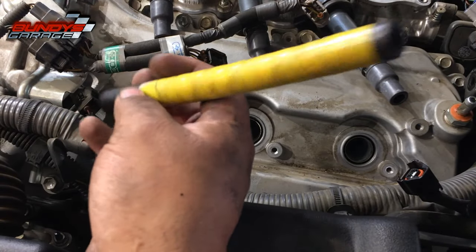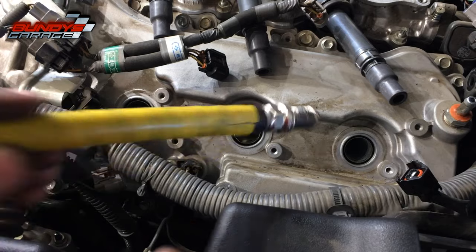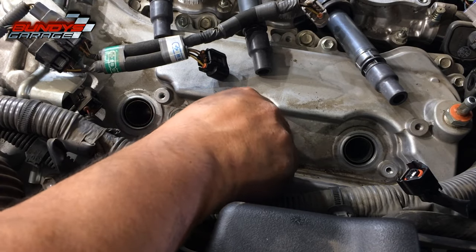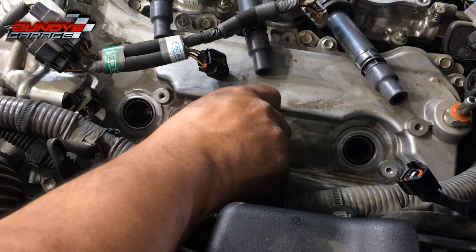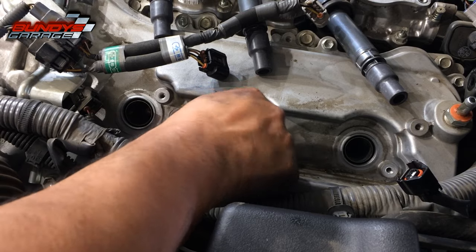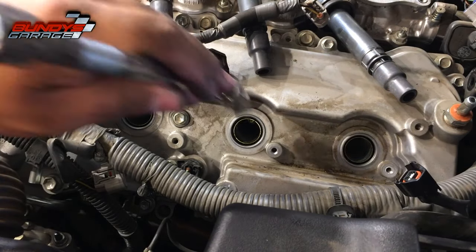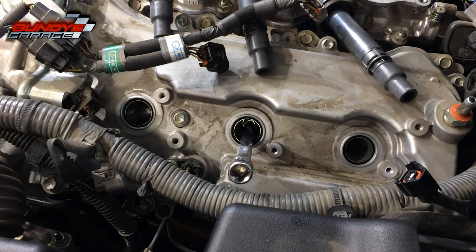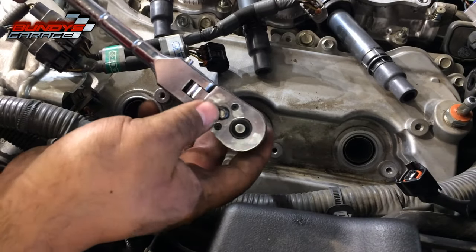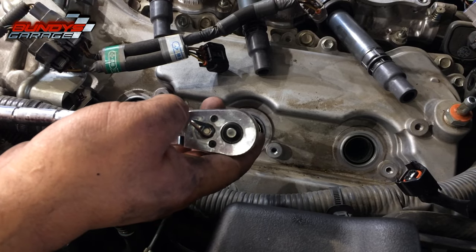I like to use a six-inch 3/8 rubber hose to guide the spark plug down into the hole. I hate dropping the spark plug — you could damage the tip. You can actually feel it when it grabs the threads, then just run it down until it bottoms out and move to the next one. That way the tip doesn't get damaged. Now take my 5/8 spark plug socket to tighten it down — you don't need to put a lot of torque on these. Feel it bottom out, then — since there's a new crush washer — give it about a quarter turn more until you feel it crush.